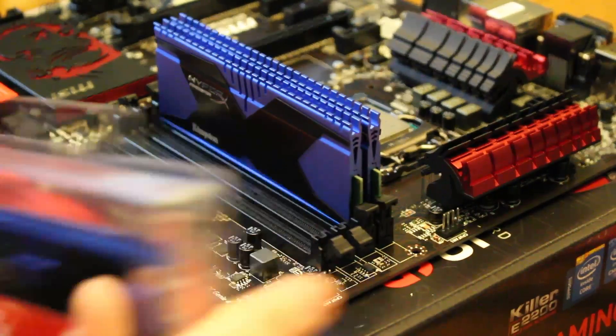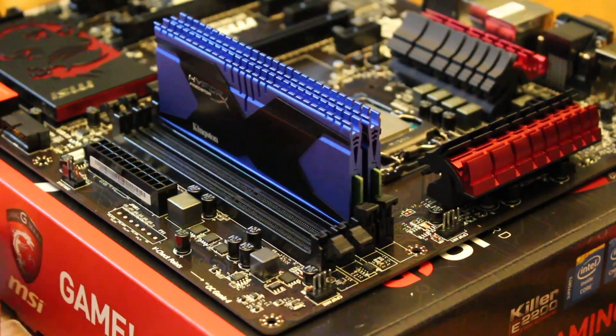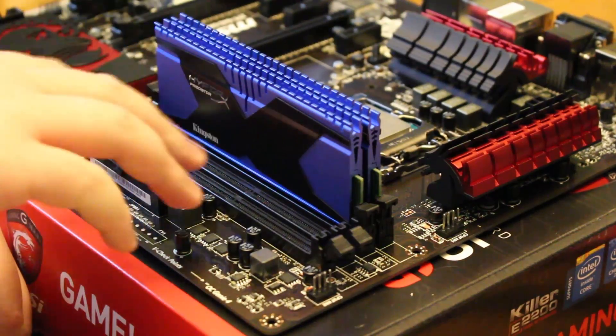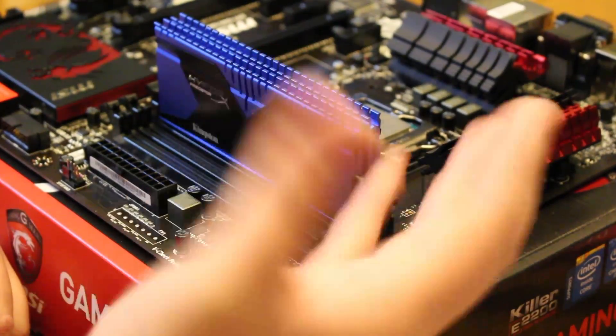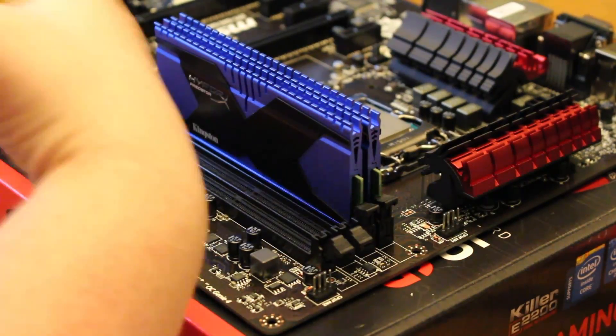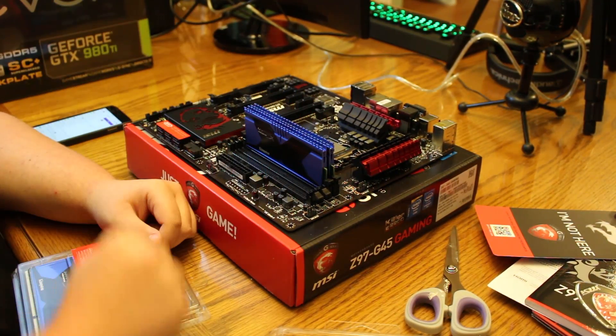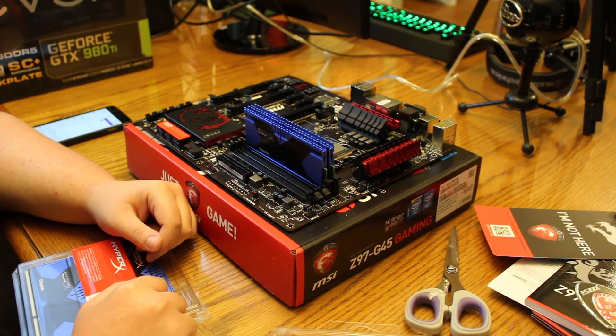There we go — there's that one. Then we've got another pack, and you've just installed RAM. I don't think we need to keep going here — it's a pretty simple process. Just click it into place and you're going to be good. You're going to have to use some pressure and some force, but don't be afraid to do that. Your motherboard's good as long as it's on a solid surface. If you're in a computer and there's nothing behind the motherboard, that could be a problem — but don't worry about it. See you in the next video, so thanks for watching.